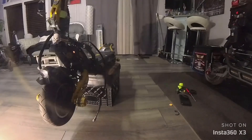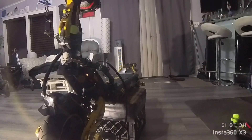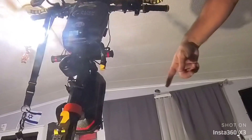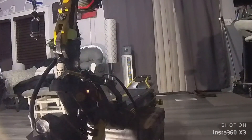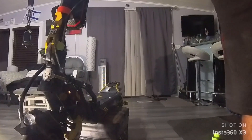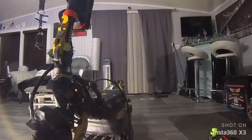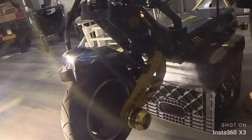When you get a new battery, you need to balance the external battery with the main battery before connecting them. For example, my main battery is at 65.3 volts and the external is at 63.8 volts. What you want to do is drain the main battery down to 63.8 or 63.9 to match the external battery's voltage. I'm putting it on the stand and running it a little until the voltages match, then I'll connect them.